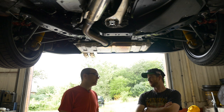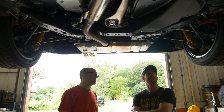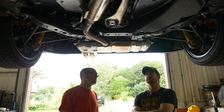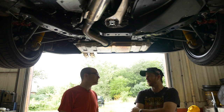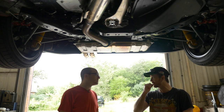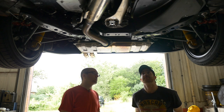More like rear wheel steer feel. Okay, so now they've reduced the toe-out effect, and now the rear end is going to toe in under load, especially, right? That was more neutral. More neutral. So no, you definitely, I mean, that car felt like it was rotating at 10 miles an hour. Right. You didn't have to drive it hard. Okay. So that's something to note.